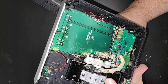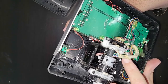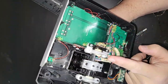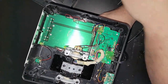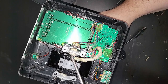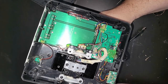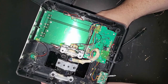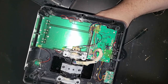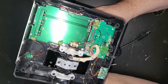They're just being bent back and forth. This kind of bending motion can cause wires to fatigue and break over time. There's some lubrication here, but the lube is getting old and breaking down. I'll fully admit that I have not disassembled this joystick and re-lubed it in the past. One thing you'll notice is that the bottom plate of the throttle actually provides the clamping force for the axis. It would be nice if they had it built so that the bottom plate could be removed, and having the throttle be still functional in that case, but that isn't something we're going to hold against them.